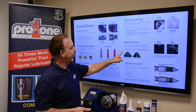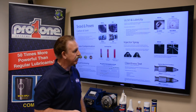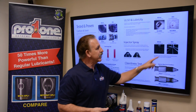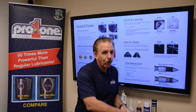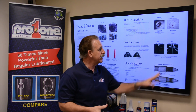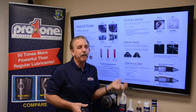Getting to the injector spray: this is the end of the injectors. Without the product you can see a lot of carbon. With it, you get a better spray pattern. Without treatment, fuel comes out in a straight line — that's how a dirty injector works. What we do is atomize the fuel. This fan-type spray you're seeing is the atomization happening before the turbocharger pressurizes the plenum with forced air — what they call boost. This is a comparison with and without. You want fuel maximizer in your system to give you a better-burned hydrocarbon.